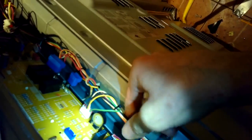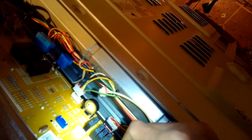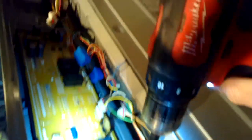I would always first try replacing the igniter because that's more commonly the part that fails. But if the igniters are new and there's still no power to the igniters, the most likely cause is this control board, which is easy to replace. Or if you notice that you're no longer getting a display, then it's time to replace the controller.